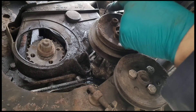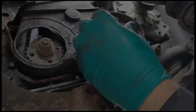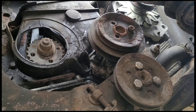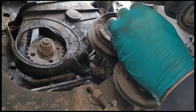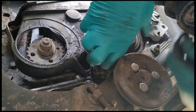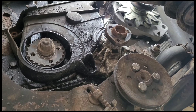Like I said, undo these bolts before you take the aux belts off, otherwise you'll end up having to get a massive pair of pipe wrenches on the pulley to hold it tight. Once they're all out of the way, there is a washer which sits in between the front pulley and the back pulley. Make sure it goes back in there, otherwise you're going to have issues with things locking up, because this water pump pulley is a slipping pulley.